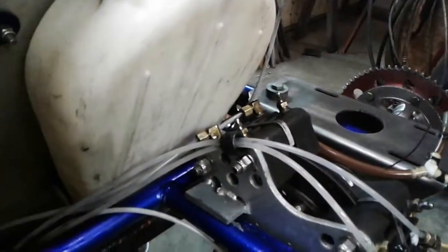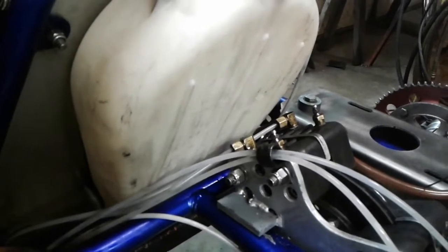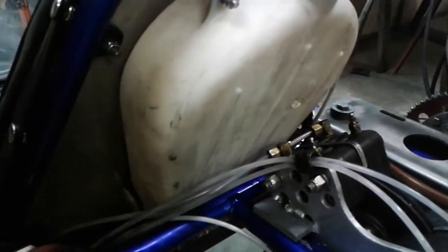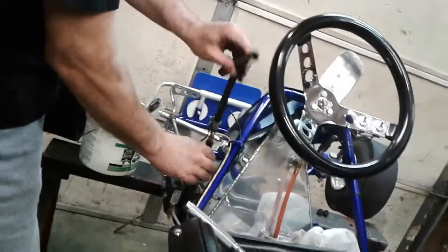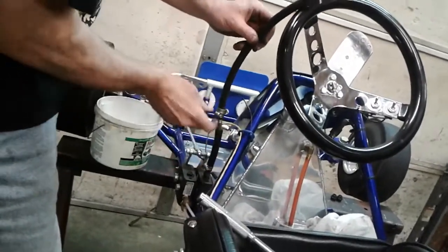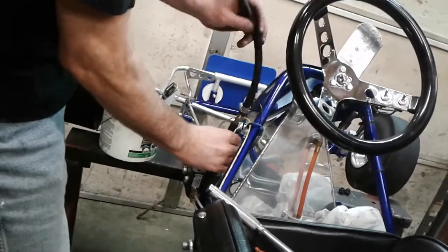Fluid came out. He's done with the pressure. That quick. There's not going to be 1 ounce of air left in that brake line anyplace. That's how you bleed your brakes in 30 seconds. Then you take this thing back out. Fill up your cylinder. Top everything off.